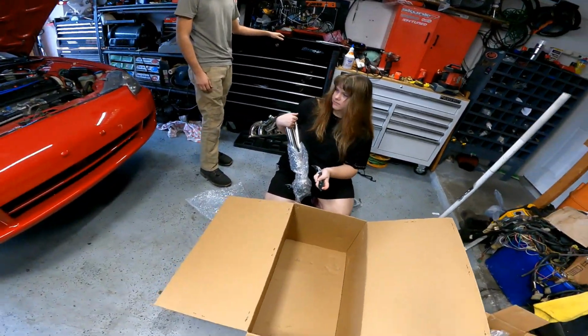So the reason we're going with that: she already has the aftermarket exhaust, but when we put these headers on, we noticed the car started turning off on her and everything. We checked all the sensors and everything, and the car is still doing that. So we're going to replace this with that. We replaced the O2 sensor twice in the car, thinking they were bad.